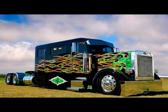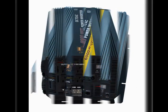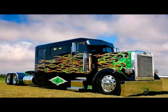To start, we're going to start with a large cabin semi-truck, which you might be using as a sleeper, so you're going to want to get a decent sized inverter, probably 3,000 watts to 6,000 watts, to make sure that you'll have enough power to power several devices, such as a heater, a television set, maybe a microwave, or even a coffee machine. For most semi-trucks like this, they'll actually have a compartment beneath the cabin that'll allow you to install the inverter right there within six feet of the batteries. You're going to want to keep the battery to the inverter connection as short as possible to keep the optimal efficiency of the DC to AC power inverter.